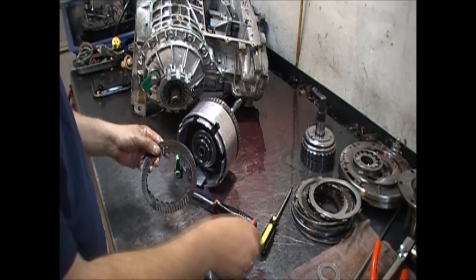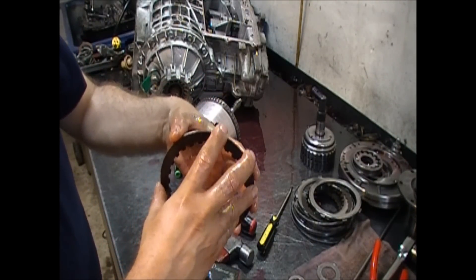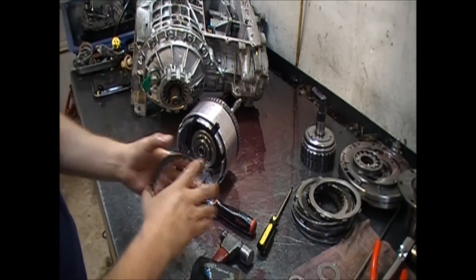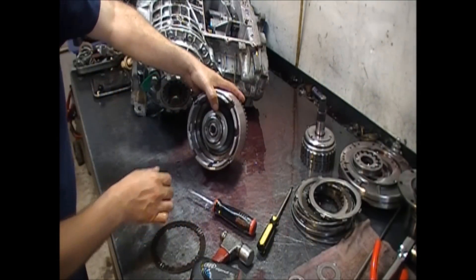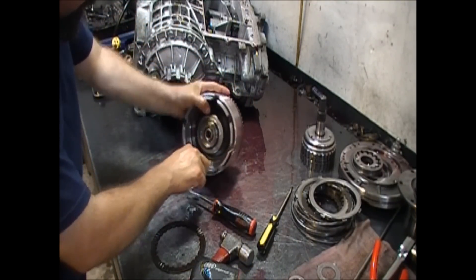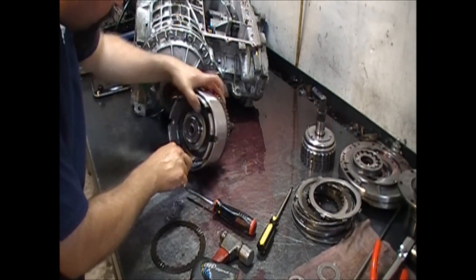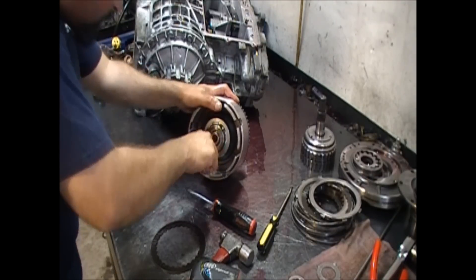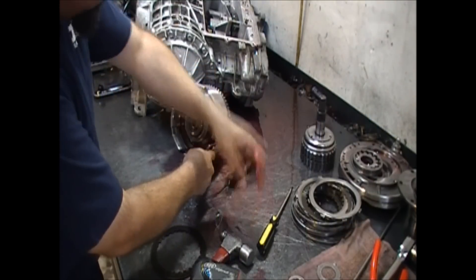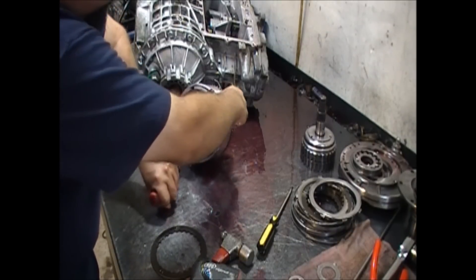We get those two hubs out, our overdrive and underdrive intermediate plate — the big step goes to the underdrive and then you have a little cutout so you can get your snap ring in there, and this side goes to your underdrive frictions. Now we get our underdrive frictions out. I have two frictions here together to adjust the clearance — this is probably our bind-up. The computer has a CVI index, or clutch volume index, and with your scan tool you can retrieve the CVI index. It would have been a good idea to do that on this unit and find out which clutch volume index was too tight.